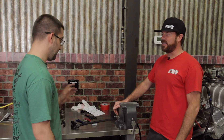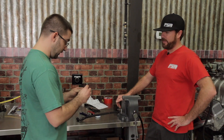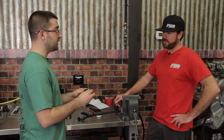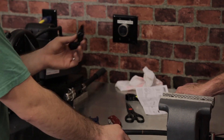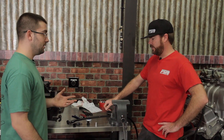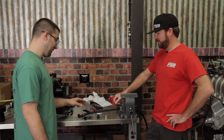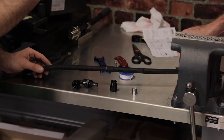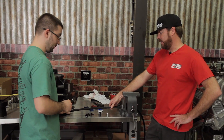This is the polyester hose with reusable or twist-on hose ends. The difference from traditional hose ends that use rubber is this one has three components: a socket, an olive, and the hose end itself. Traditional hose ends just have the socket and hose end — they seal by compressing rubber. This one seals differently: it takes the inside ribs of the PTFE liner and compresses them. So it's gripping the inside of the hose rather than crushing the outside.